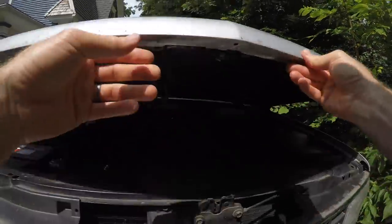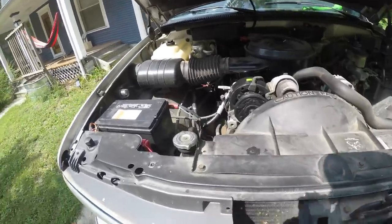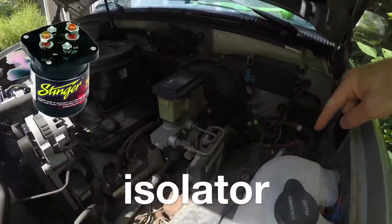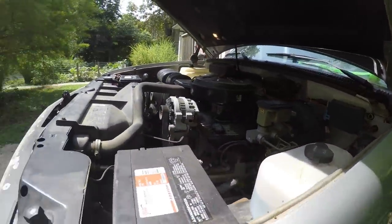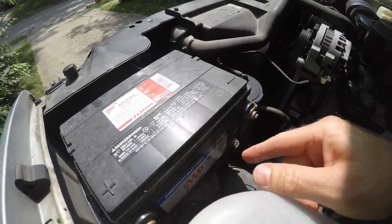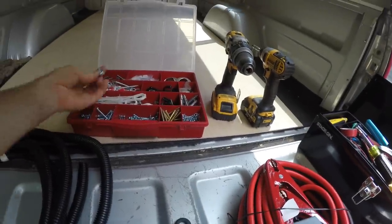My truck is a little different than many — I've got two batteries. This is my main battery that the truck runs off of on the left. A cable runs over to the isolator, and then from the isolator you go to my second battery. So I'm running the inverter off my second battery. You don't have to do that, but if you have a second battery hooked to an isolator, it's great because you can run the inverter without the truck running and it's not going to kill your main battery.